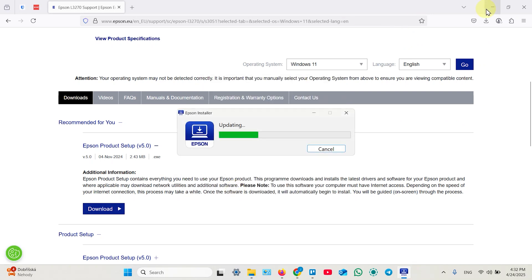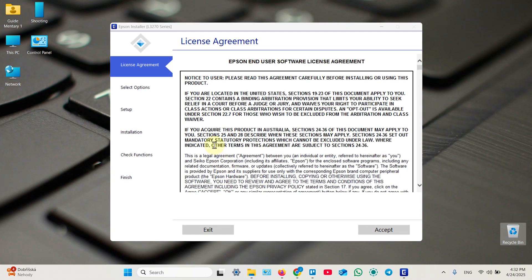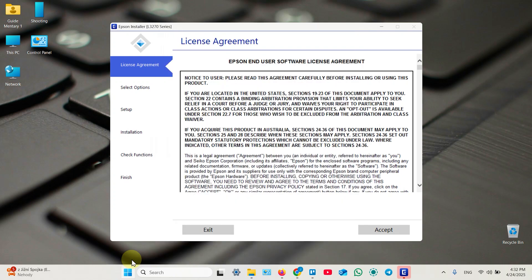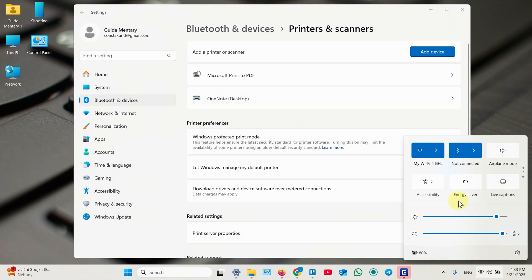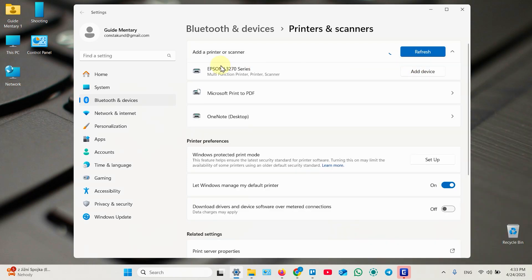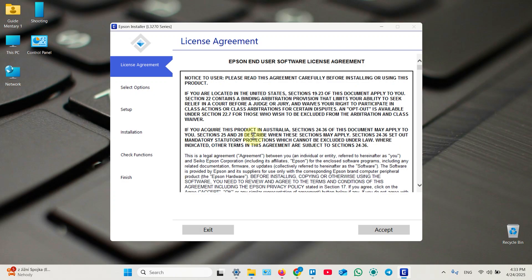You can minimize or close your browser. While the app is launching, I recommend you add the printer to your printing system manually first. Click the Start menu and type printers and scanners, then select that option. Click Add device — make sure you're connected to the same Wi-Fi network as your printer. Your printer is found; click Add device once more and wait for the connection. Now it's connected — minimize the settings and continue in the application.